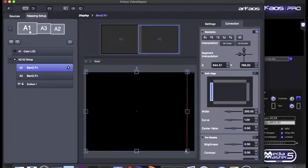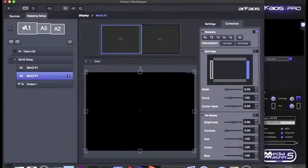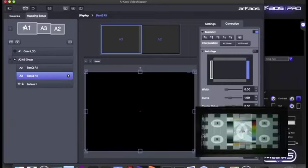So for now, I'm going to leave that projector and go over to my left side projector, because this one here is going to be a lot more work as far as getting it lined up. If you can see, the bottom of that left side projector is bleeding lower than the right-hand side. So obviously we can't extend the right side projection further down. We're actually going to have to shorten the left one up to match the right side of the projector.